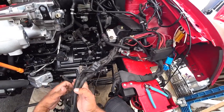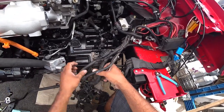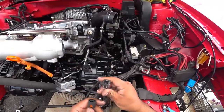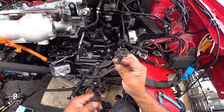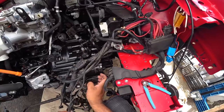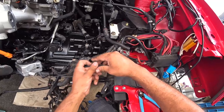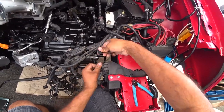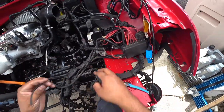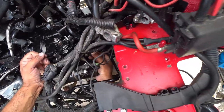Right at the start, there are going to be two sensors coming right off of here. They look very close to each other, but they're actually not the same. This is the starter — solid starter solenoid wire — and this is your reverse light. So this is for your starter right here. We're going to plug this in, and then your reverse light switch is down over here.